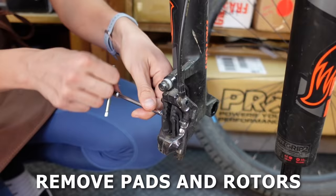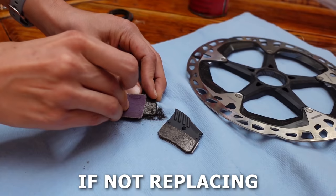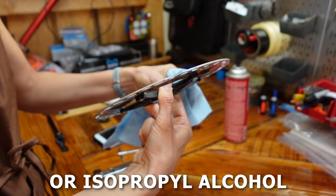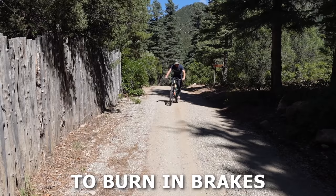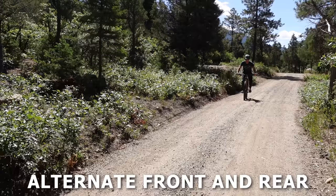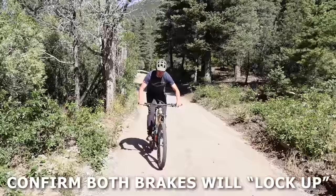Here's how to sand and burn in your brakes: First, remove your pads and rotors and inspect them. If the pads are severely worn or the rotor is burned or worn out, replace as necessary and skip the sanding and cleaning steps. If they look okay, take sandpaper and sand off the top layer of the pads until they are no longer shiny or metallic. Blow off the dust, then scuff up the rotor until it is slightly scratched. Clean with a non-chlorinated brake cleaner or isopropyl alcohol. If you think you may have gotten a contaminant on your caliper, clean the caliper too. Reinstall the pads and rotors and put your wheel back on. Burn in the brakes by pulling each brake to 75% of max power for three to four seconds without coming to a full stop — ideally on a slight hill. Repeat five to ten times per brake, or until you start to feel it bite. Confirm it's burned in by making sure you can lock up each brake all the way, via a stoppie or a skid.